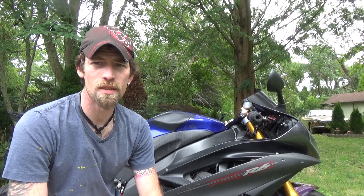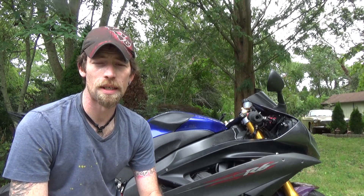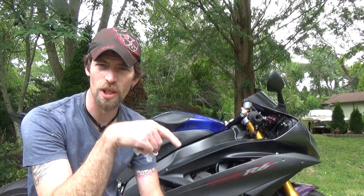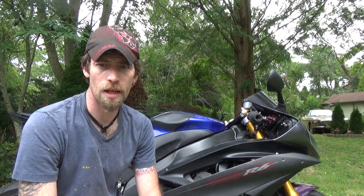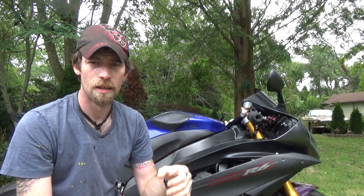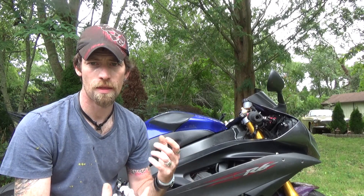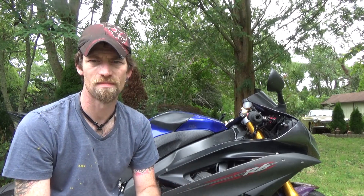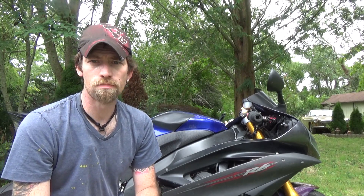As I mentioned, I bought this bike for $1,500. The guy I bought it from said it had a spark plug port in the cylinder head that was jacked up and needed to be re-threaded. That was true. So I bought a tap with the right thread and bought timeserts, which are threaded sleeves - threaded on the outside and inside. You tap the hole, screw in the timesert, and now it's the same thread size as your spark plug. It's a little better than a standard helicoil.